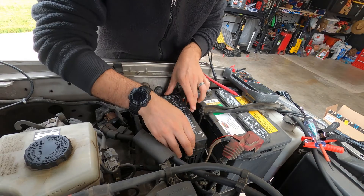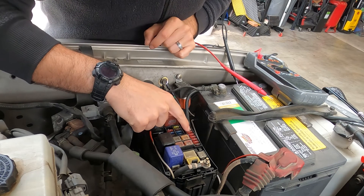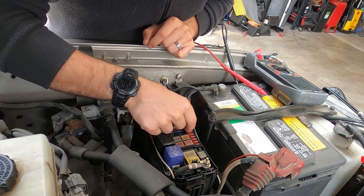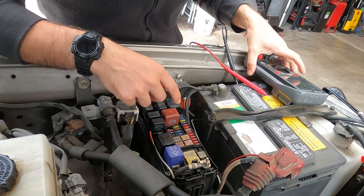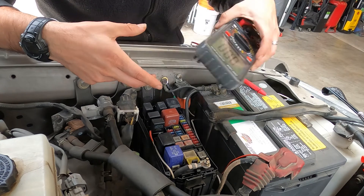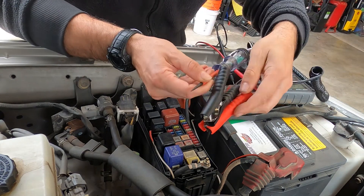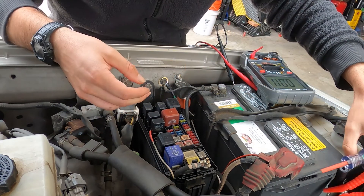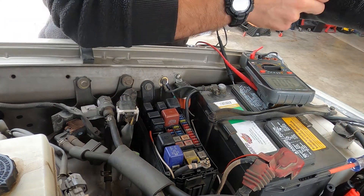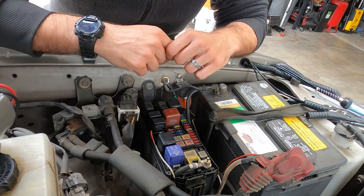So there's going to be three ways to test this. Once we get the cover off, we will pull the fuse in the location here and just do a visual check to make sure that it's not blown. We can also use a voltmeter, which we'll do. And we can also use something like a noid light or a circuit tester like this as well. So we'll actually do all three here. And we're going to test the fuses on the left and right side. You have to do this test while the headlight switch is flipped on.